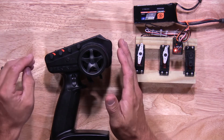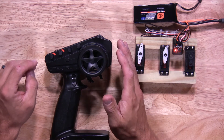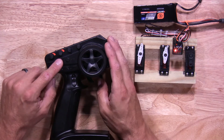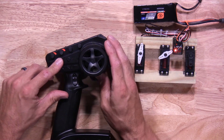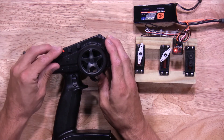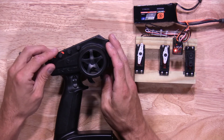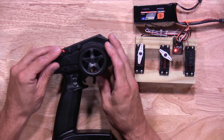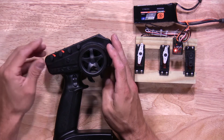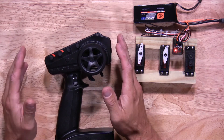You have the option to stop here and turn the transmitter off to save your settings. But if you're going to do throttle as well, as we are here, the next thing will be your throttle, and it's done by the brake rate knob. Here's your max throw on your throttle and brake, so we're going to turn it down about halfway. That's our brake. Here's our throttle — about halfway as well.